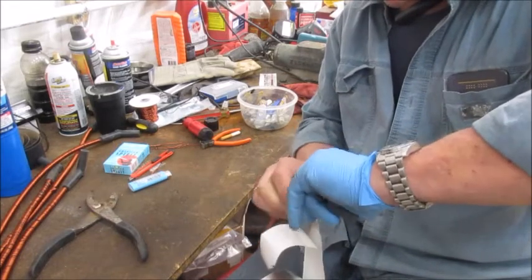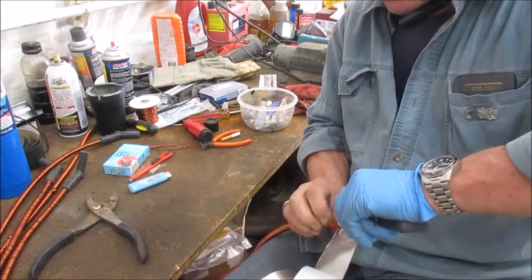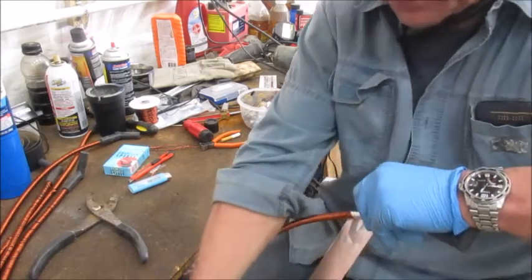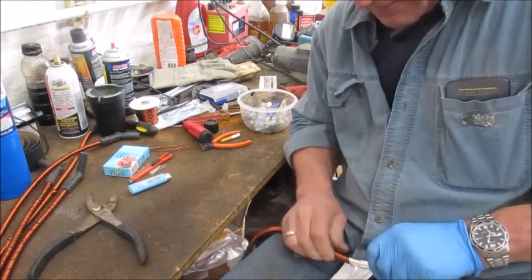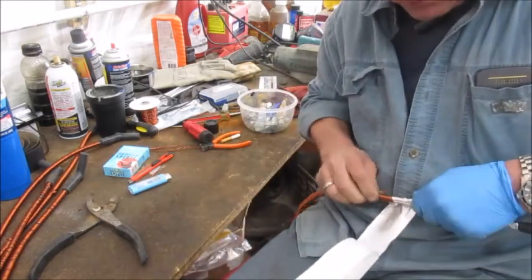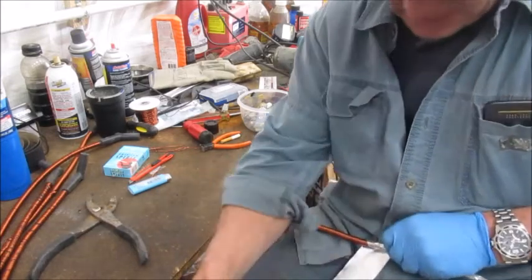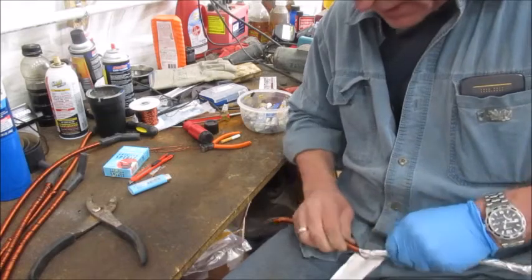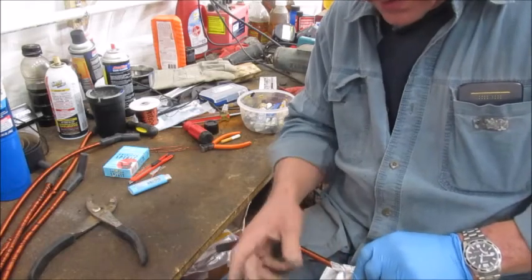You have to keep it tight on the side that's already wrapped because as it starts taking up more space it won't stay at a 45 and that's why it gets wrinkly. Adding the aluminum tape to the outside of the plug wires will also reflect a good deal of heat and makes your plug wires last longer, so you're going to get super-powered spark — especially if you do the copper coils. This is maybe a couple dollars worth of aluminum tape; it's pretty cheap stuff.